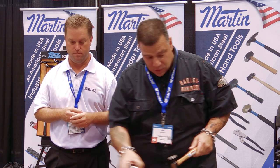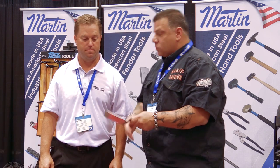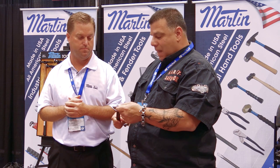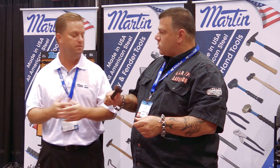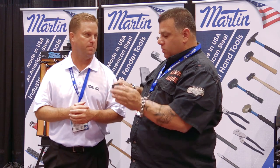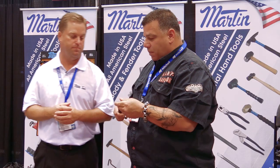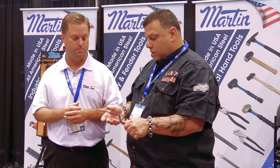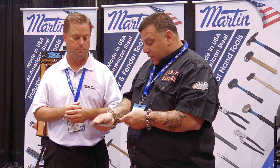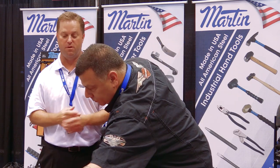Years ago I took classes on panel repair and we had slap hammers. Now this spoon is obviously way too light and thin to be a slap hammer. It's basically a spoon for doing creases — getting into behind areas. If I've got to get into a thin area like between a fender and the fender lip, I need to do a little pushing and get an edge on a panel or feature line. They're all tempered steel so they're really strong, with a good coating — 100% US-made alloy steel.